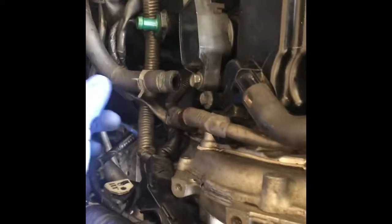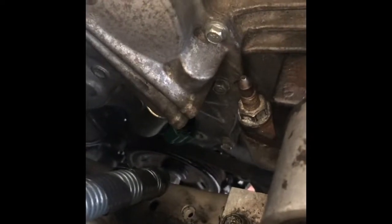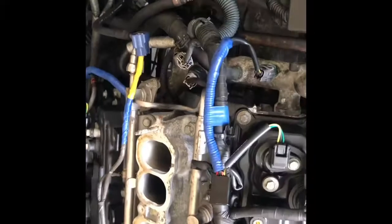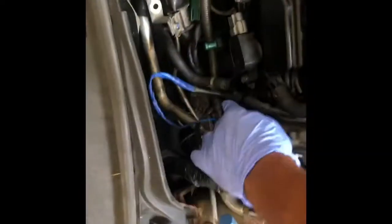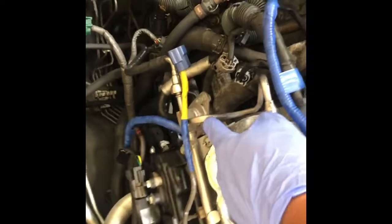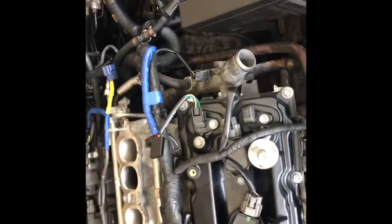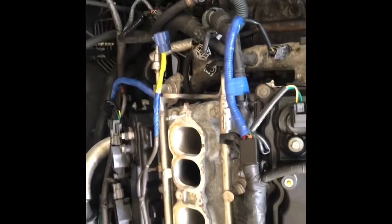So essentially, you're going to unhide or untuck it. It's going to be here. You cut and then extend down to where you see that green clip. So just wanted to let y'all know: remember, your green clip in the back may be hidden. Just look for it. It's about that long. You'll find it. Extend that one. Do not cut and extend the one for the evap. Don't do that. Working on the manifold now, and I'll get back with y'all once that's updated.